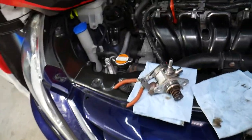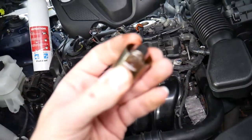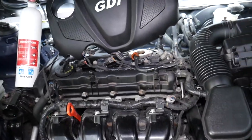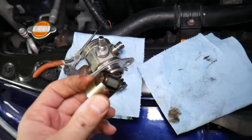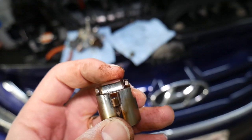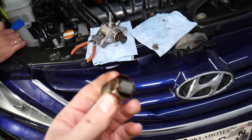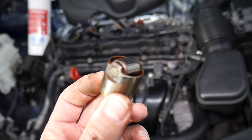So if that bearing fails, you develop play, and that play will be metal on metal. That metal noise will be amplified by the fuel pump, and you're going to hear a loud noise on the upper side by the direct fuel injection pump. In some cases it could also be a bad pump — a good follower but a bad pump. But if you replace the pump, I always recommend replacing the follower as well. Inspect it and make sure it has absolutely no play up and down — some sideways play is fine, but the wheel should have absolutely no play. This is a very common issue on higher mileage vehicles.